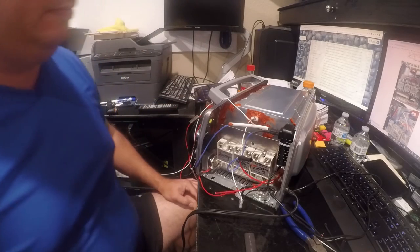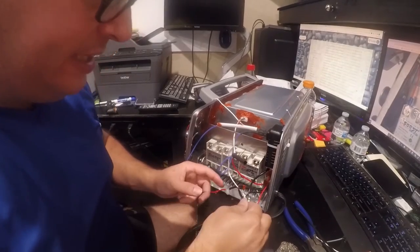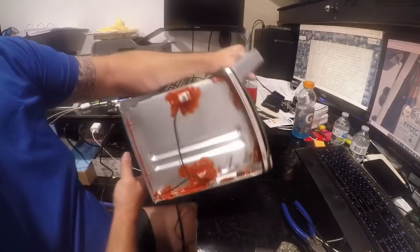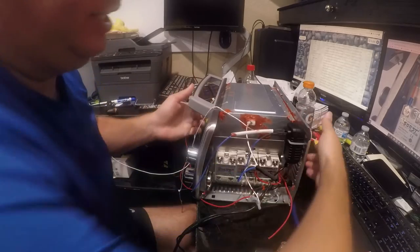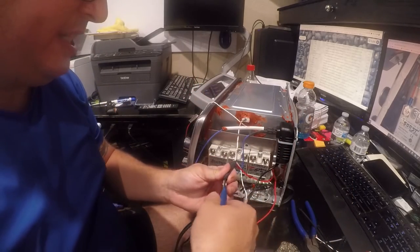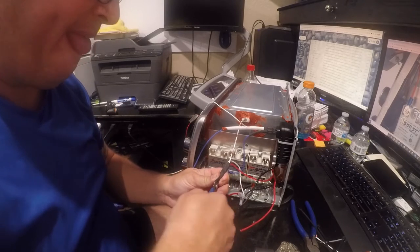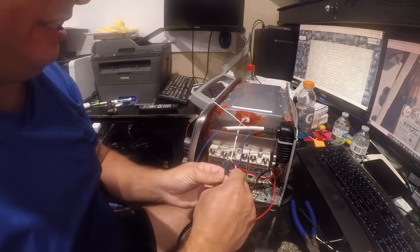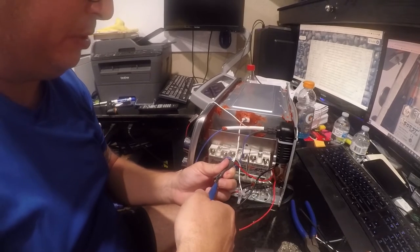Well, hang on a second. I gotta look at some wiring. I did not realize that this wire here goes to this side and splits and handles both of these. So these are actually 110 volt elements. So what we need to do now is take this all apart. Because it's wrong. And again, I'll figure this out, but these are some crappy instructions at this part of the build guide.